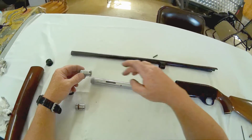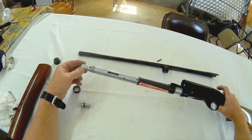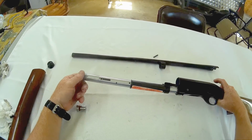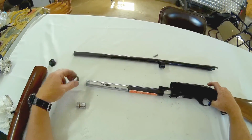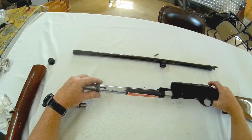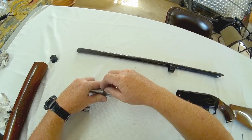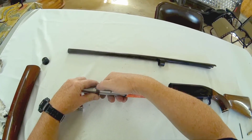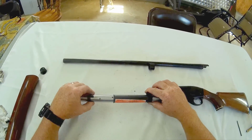What you need to do is make sure that this hole is lined up right here on this exhaust. Or you got to get that thing in there with your finger. Line it up. Okay. Next comes this ring that goes over the outside. And then you go ahead and put your pin in. And this is a little fun sometimes, getting it lined up. And it's pretty easy. So you want that sliding real easy there, okay?